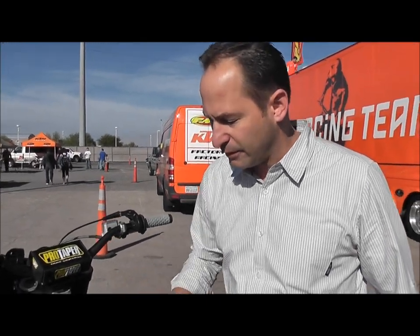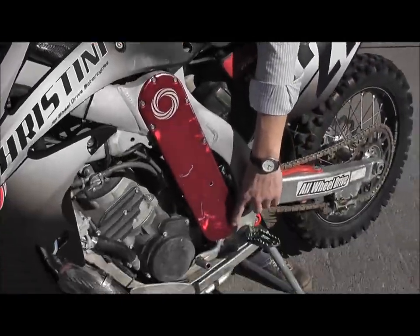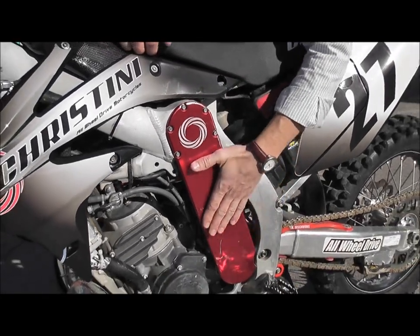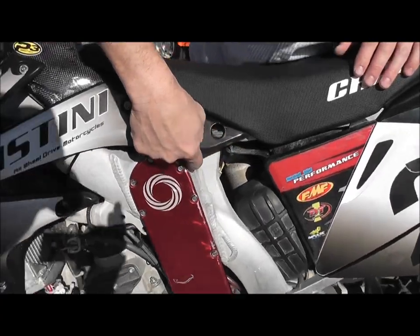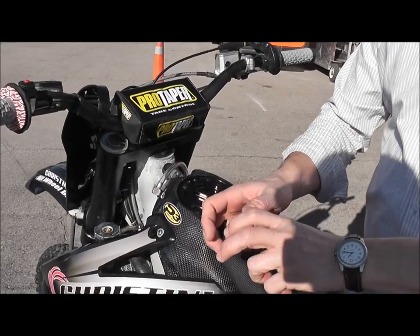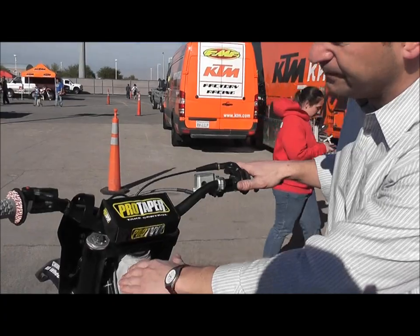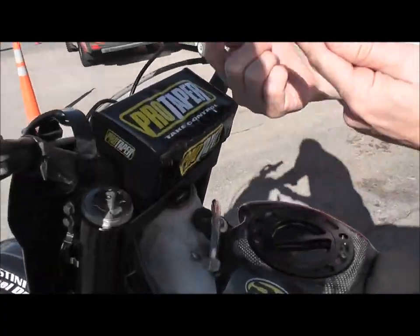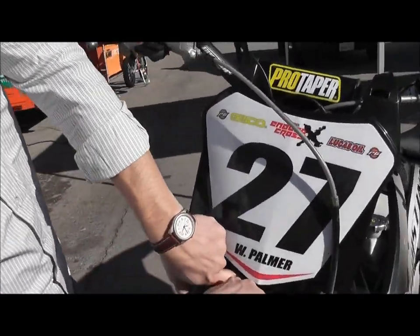From a tech standpoint, I'll give a quick overview. You essentially have the drive system that comes off the countershaft sprocket underneath this chain. There's a gearbox that goes behind the chain, a drive shaft that goes up into the head tube, and inside there's a torque limiting clutch that keeps the front and rear from overloading. Once the drive system gets into the head tube, there's a drive gear on the bottom and one on the top — they counter-rotate and go down into two step-over chains.